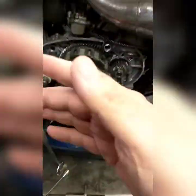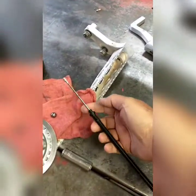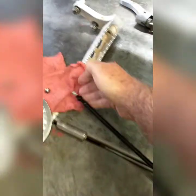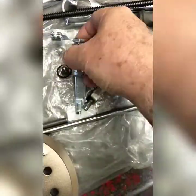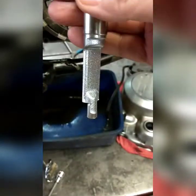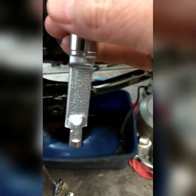On a Banshee clutch, when you pull the lever it pulls the cable. Here's the new cable I'm going to put on - the other end's the lever. When you pull the lever this cable gets shorter, it pulls in like that. That pulls this arm right here on the other side of the engine and turns it like this.